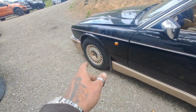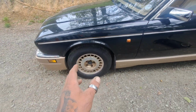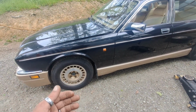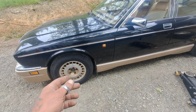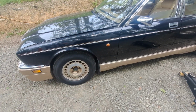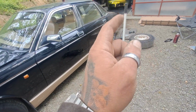Like I said, I don't want to open up the front wheels 0.6 of a mil just to put them on. It'd be nice to see fronts on today as well, but I'm not going to do that because I think I need about 20 mil spacer. So I'm getting some bolt-on spacers. They'll be here in a couple of days. And what I'll do, I'll open up the inside of the spacer to go over the hub, and the outside of the spacer will perfectly match the wheels then.